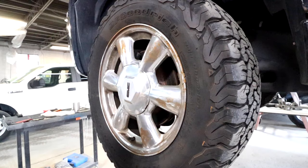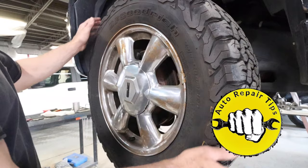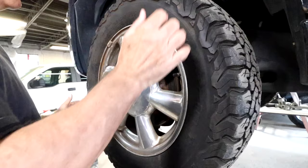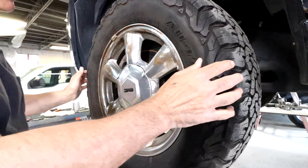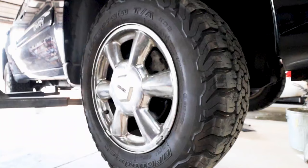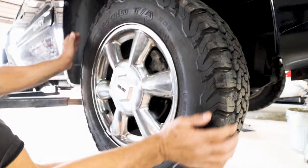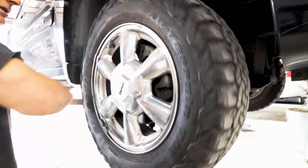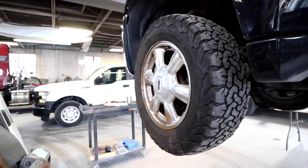One of the first things you want to look at when you're having noise in the front wheel is grab it and shake it — and that seems pretty tight. The next thing we want to do is turn this wheel and try to spin it. You can actually hear the noise, but one thing I've noticed is when I'm spinning it, it is extremely tight — no extra spin on this thing, it immediately comes to a stop. Let's compare it to the other side. Same thing when you grab this wheel top and bottom — it's nice and tight. Let's check the spin on this tire. See the difference? When I spin this tire, it continues to turn. So what that's telling me is the caliper on the other side is probably sticking or locking up, or it could be a brake line.